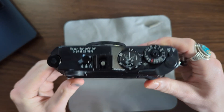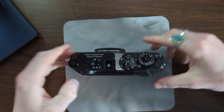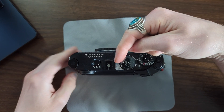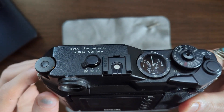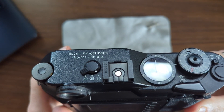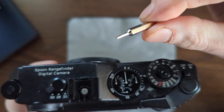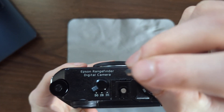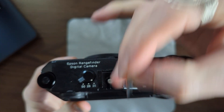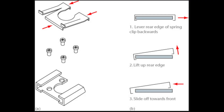To remove the hot shoe, you have to do two things at once. There are two vertical retaining clips that go down this way on the hot shoe. We need to get leverage pushing the hot shoe back while also pushing it up at the rear. I'm taking an extremely small flathead bit on the screwdriver — very, very tiny — and I'm going to push it in right into that spot, tilt it back to lever the hot shoe toward the rear of the camera, while using my nails to lift up the rear of the hot shoe.